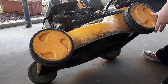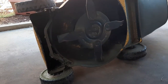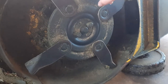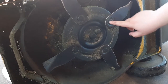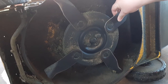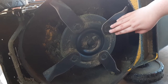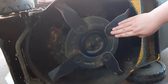Remember it's heavy so be careful — you might need a friend to give you a hand. Very gently over to the side. Now you'll see down here are your blades. You want to make sure that these are nice and tight, simply by swinging them around — you'll feel whether it's tight or loose. You can also see that your bolts are nice and tight. Your blades have this bolt here — make sure it's tight and not moving around. If it's wiggling, the blades can come off and cause really bad injuries. So always make sure these are tight before you start your lawnmower.